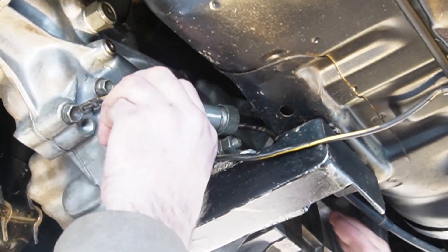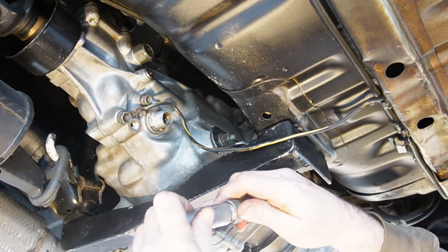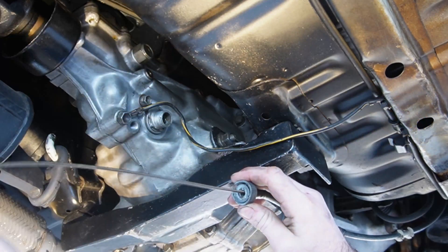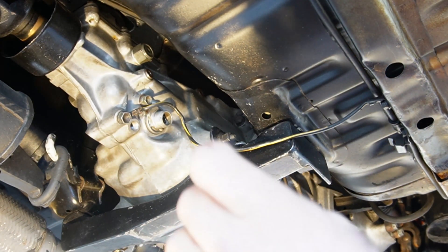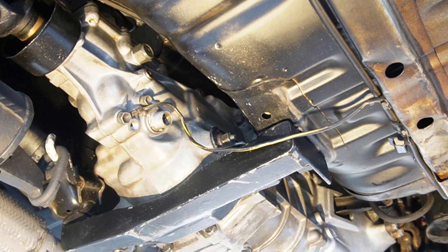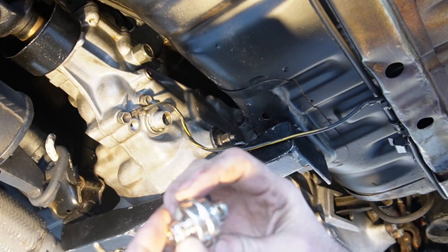The first thing I'm going to do is remove this mechanical drive out of the speedo 90-degree fitting, and then undo this from that. What we have here is the speedo drive — you can just pull it out. This itself has a spline bit that goes into the speedo drive, so we don't want to cut this bit because this is what slides through our sensor. You can see it would go through there and there are little locks on it that we would lock off.